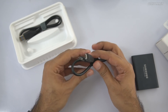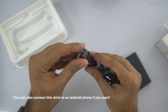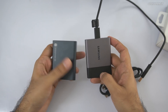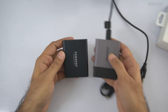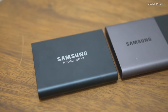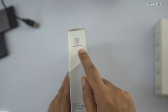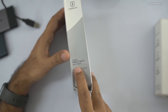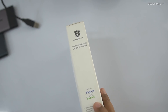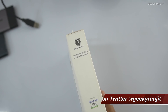So if you have a new laptop with a Type-C port, you can connect directly using that cable, and if you have an older USB Type-A port, you can use the other one. In terms of size comparison, both the T3 and T5 are almost the same — they didn't make it smaller, but it's still very compact. Weight is also about the same. Color-wise, the older T3 had a multicolor finish which I liked personally, but this T5 is completely black. Both carry a three-year limited warranty, and the T5 supports USB 3.1 Generation 2, meaning speeds up to 10 Gbps, whereas the T3 was USB 3.1 Generation 1 at only 5 Gbps — so theoretical speeds have doubled.